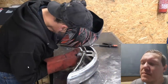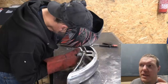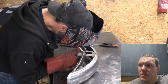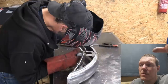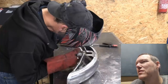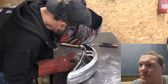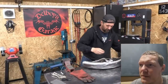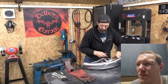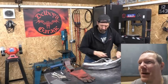Here's the thing - he put the mudguard on the bike with the tabs, bolted everything together and clamped it. Why not just undo the bolts and take the whole thing with you? If you'd clamped it all up you wouldn't have to mess around re-lining everything up or drawing silly lines on it. And this whole plug weld then seam weld thing is a bit daft - you could just do a seam weld across it like a butt weld, turn it over and do the inside. That's easily enough.